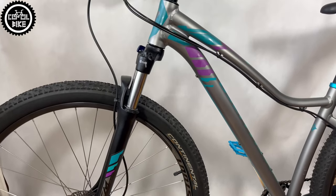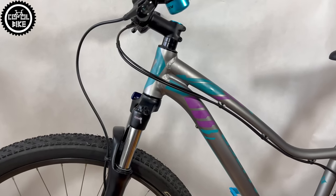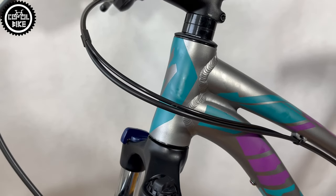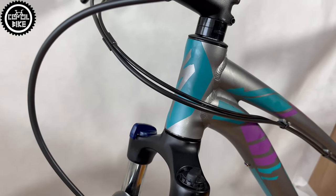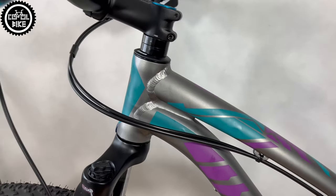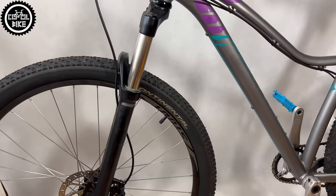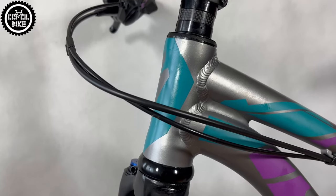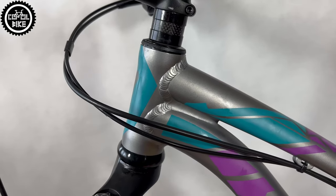Here is an example of a Specialized Jet before and after the treatment. Links to that and my other videos you will find in the top right corner and in the description. You also have to remember that the bottom cup is taller because it must now accommodate the bearing. The distance between the shock axle and the head tube of the frame will be extended by about 1 cm, so the fork angle will slacken by approximately 1 degree.